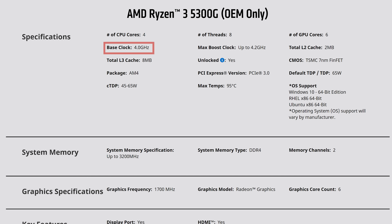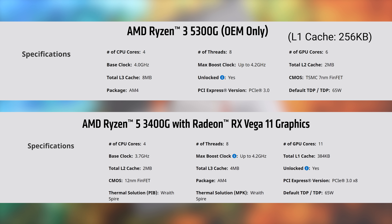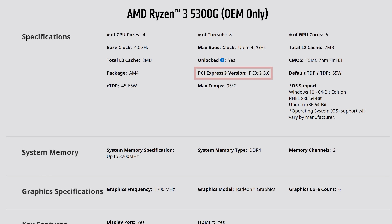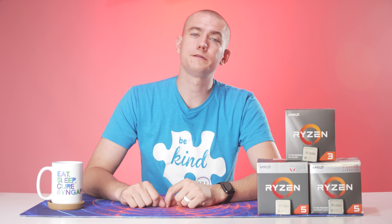The 5300G: four cores, eight threads, 4.0 GHz base, 4.2 GHz boost. Same six GPU cores as the 4300G at 1700 MHz. AMD has announced tweaks to the Vega architecture so it should be faster than the previous generation. One thing to note about cache sizes on the 5300G: slightly less L1 cache at 256 KB versus 384 KB on previous Ryzen 5 chips, but the same L2 cache at 2 MB, and then double the L3 cache — what AMD calls game cache — at 8 MB. The Ryzen 3 5300G can't run anything more than PCIe 3.0, but with a quad-core chip, do you really need it? I'm actually going to test that in an upcoming video. So get subscribed to UFD Tech to stay up to date.